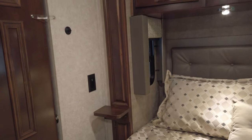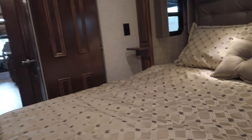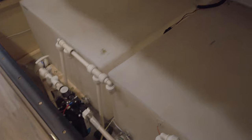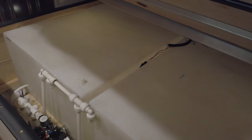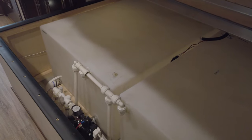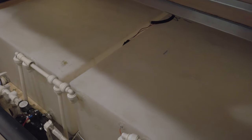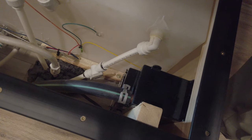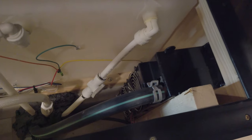Taking a quick look underneath the bed, there's your water pump. You've got two 75-gallon roto-molded water tanks. Roto-molded is the same way they manufacture whitewater kayaks — super durable, can take a beating, and don't have seams that crack easily. They do it in two separate tanks to minimize the slosh from front to back as you're driving. Right there is what one of the radiators looks like for the AquaHot system — you can see the fans in the back. Hot coolant circulates through it and the fans blow that hot air throughout the coach. Those fans are no louder than a computer fan.